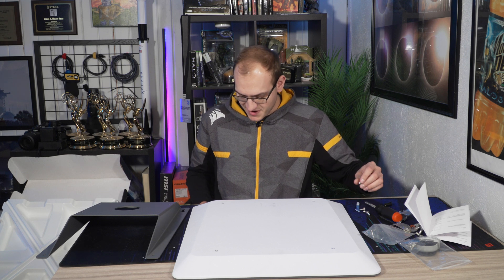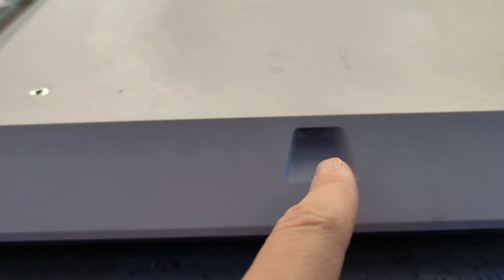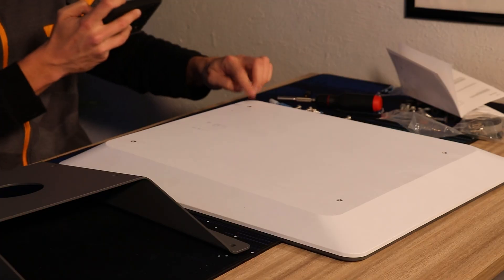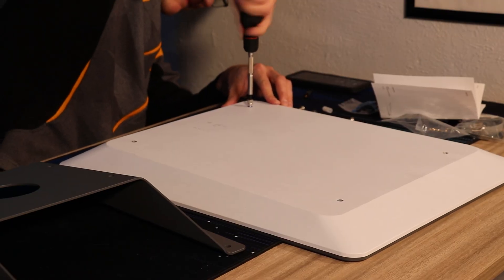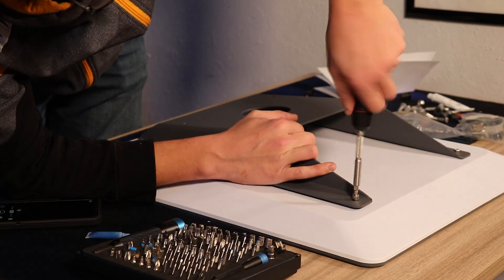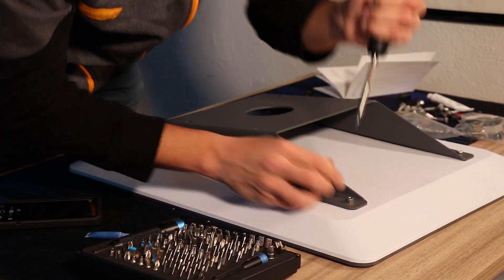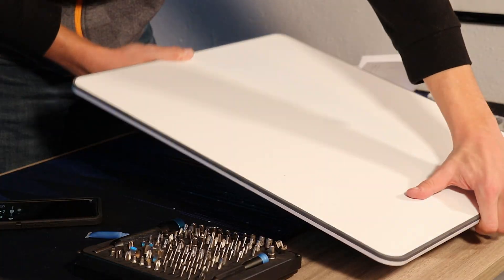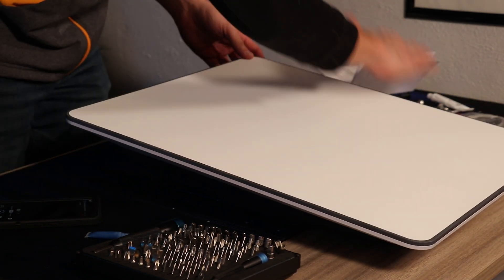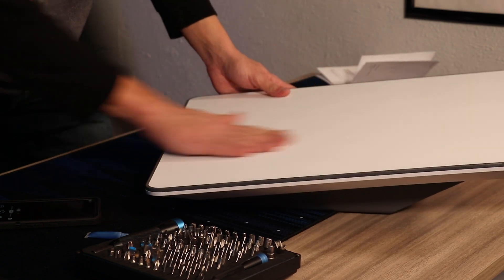What we're going to do is install the mount properly on the dish. Lay the flat dish here — make sure it's on something that's not going to scratch the top of the dish. You're going to use these tiny little bolts — they're kind of the locking bolts. These two will go into the holes that are closest to the cable port, and then these other little guys will screw in up here after the mount goes on top. So you'll do those two bolts, slide this thing in, and then do those two. So just like that, you have the mount on the dish, and you can see it's a bit of a slant to it — not perfectly flat. The lower end will be on the front of the car so it's a little bit more aerodynamic as you drive.